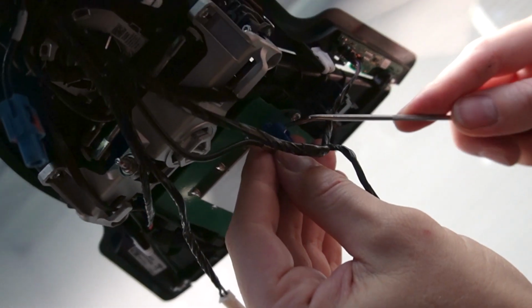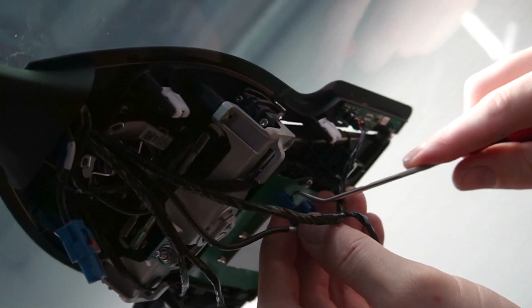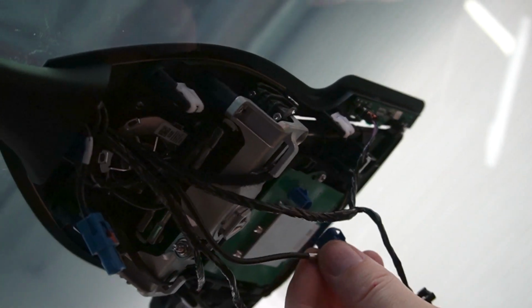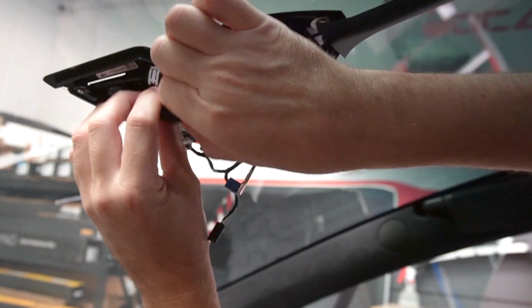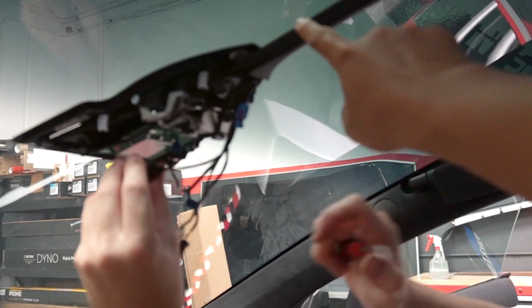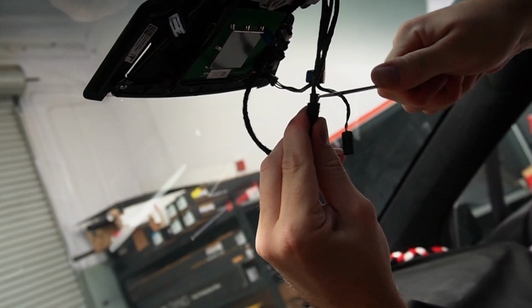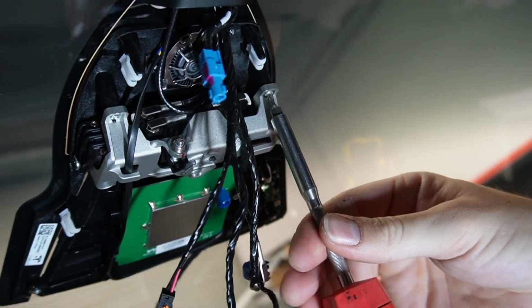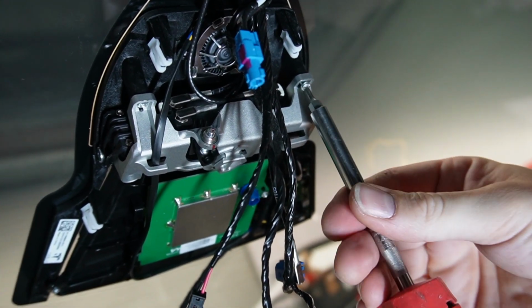There's another thing, guys, don't forget, you pull it and it still has a lock. So don't just assume once you remove this it'll pull out that easy. This one I can't. Clips. Oh, so we have to unplug everything that's connected to the front camera. Correct, yeah, everything that is bundled in because this whole channel has to come out, right? Correct. So we're gonna remove this metal bracket that holds the actual rear view mirror. Okay, so that's a T10, right? T10.